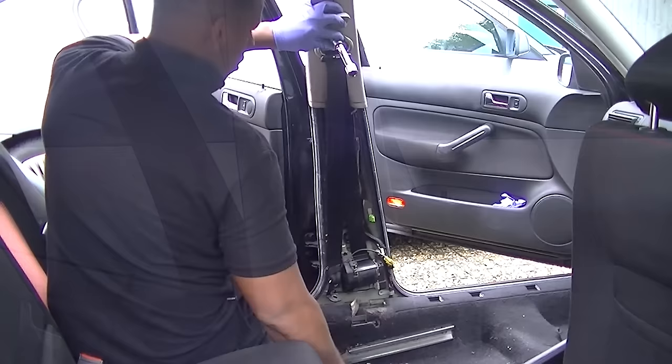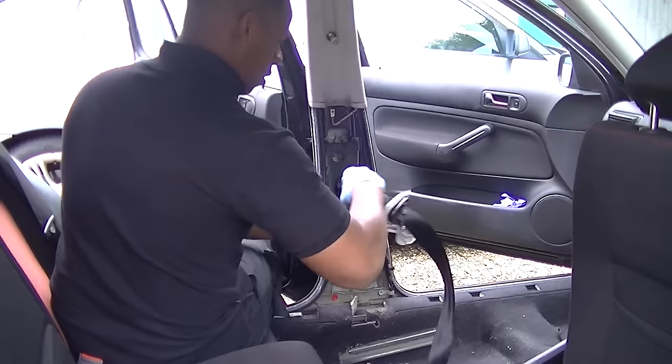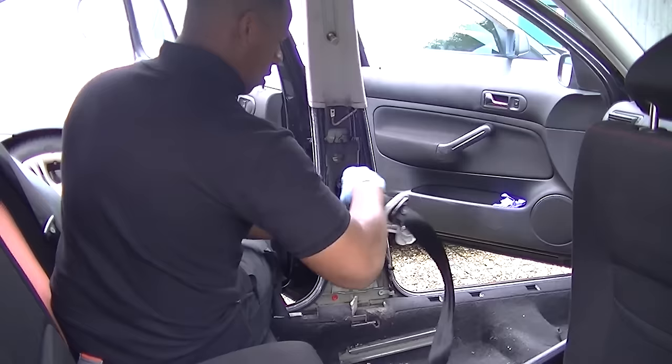Now undo the top of the seat belt — just open that cover up, and once again it's the same size as the bottom bolt though I don't remember the exact size. Once you've done that it's all pretty simple. Just lift it up and out — it's got a little groove which it sits in. I always wrap it up this way because if it goes all the way in it locks and you can't get it out. That's how you remove your seat belt — hope that helps, comment, rate, subscribe, thanks for watching.